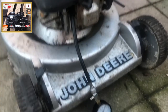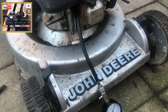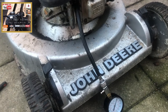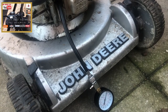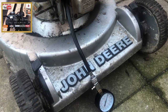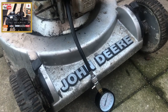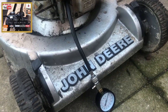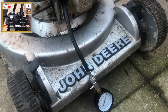The purpose of this video was to show that when a machine with an overhead valve has got no compression, the initial step is to get the valve cover off the head and check the valves and the clearance on your intake and exhaust. The valve stems weren't in situ on the block, and the clearance on the valves was miles out. It should be four or five thou for intake and exhaust. But we've got 60 psi now.